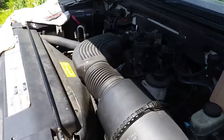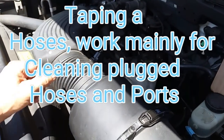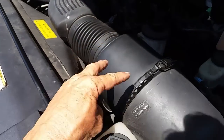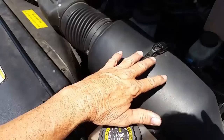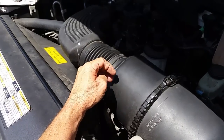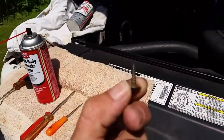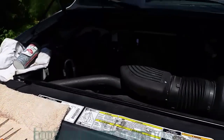On a lot of vehicles you can tap into a hose, but the problem is the engine will die — it's sucking too much air in, and you've got to run back and grab the throttle to keep it running. It's a real pain. Also, if you bring airflow across certain sensors while the engine is running, it may throw a check engine light, opening up another can of worms. So I'm going to show you a little trick.